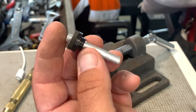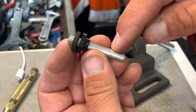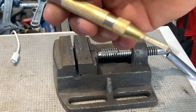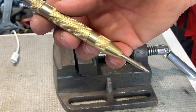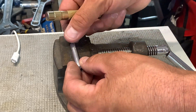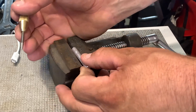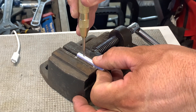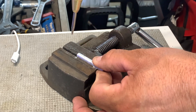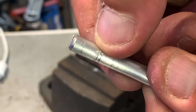I've cut four of these aluminium body posts — that's what they're going to look like. All I've got to do now is drill a little hole where it's going to screw into the shock tower. If you don't have one of these, get one — it's a pilot hole punch. Because it's a round tube, once you've scratch marked the spot, you just push down, try to get as centred as you can, push down, and you hear a click.